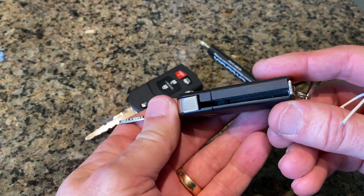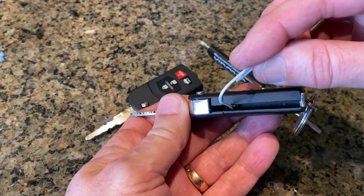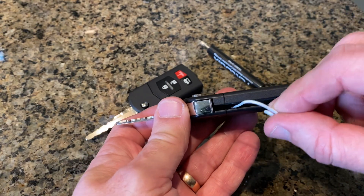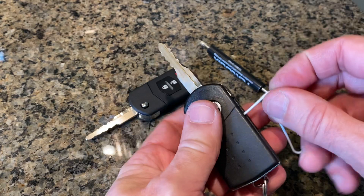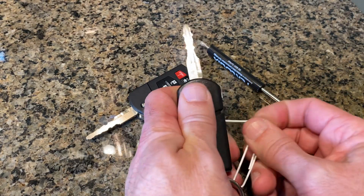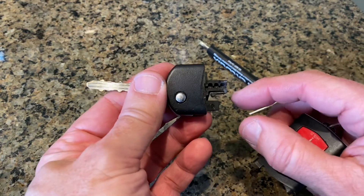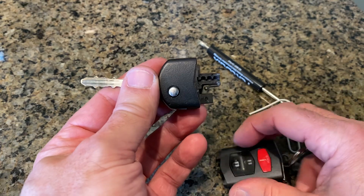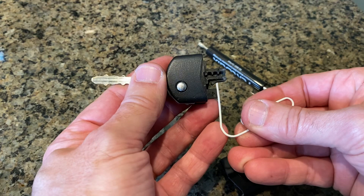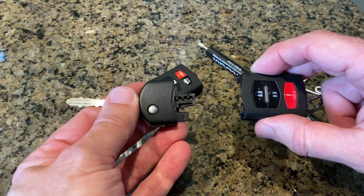And in here, you can see there's a little slot here, and you want to push the paper clip into that. So I'll line it up like that. What you want to do is push that in with a little bit of force and then sort of pull this up with your thumb as you're doing it. By doing that, you're actually pushing down on this little catch here, releasing it like that, and that's allowing this to slide out from here.